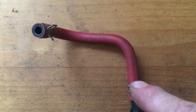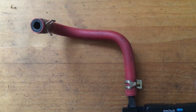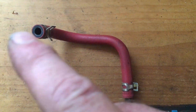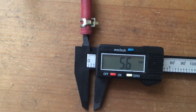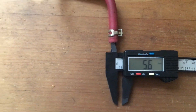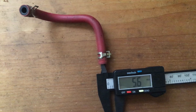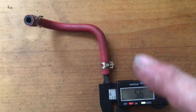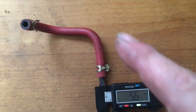This fuel hose goes up near the fuel pump, so that's one of the fuel pump hoses — 6 millimeters. I've heard six and eight mentioned as well, but I've always used 6 millimeters. Even if you used 8 millimeter hose after that, it's still restricted by this genuine pipe.